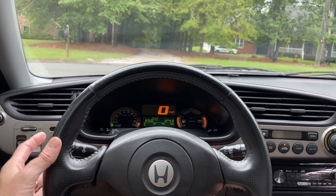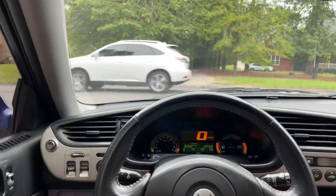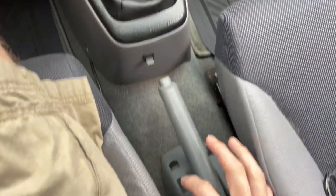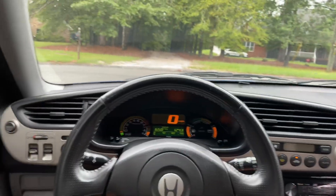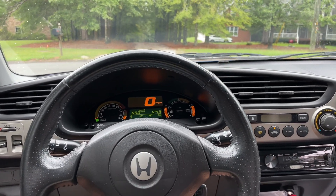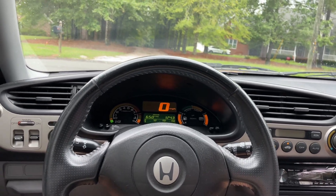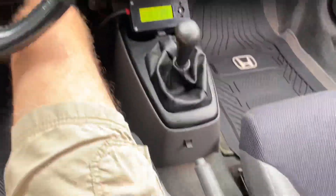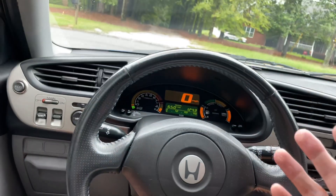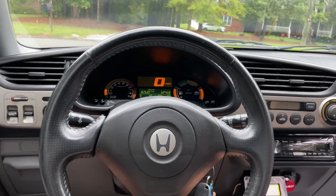When you have manual control of the car as I do through John Sullivan's tech — I've also linked videos on that — you can actually manually control the throttle using this knob. When I say throttle, I mean the amount of electric motor throttle you're adding. That enables you to add more from the very beginning when you push the gas, because the car itself will otherwise modulate when and where it adds the electric motor. When you can manually control it, you can add it anywhere and go 100%, which makes the car significantly faster.